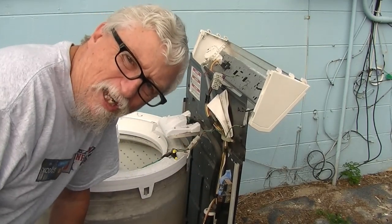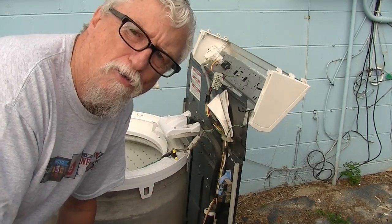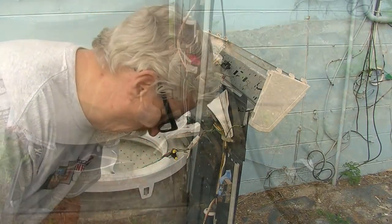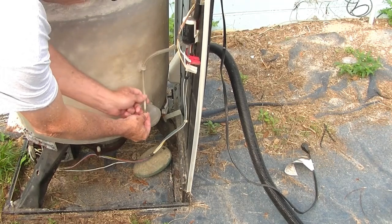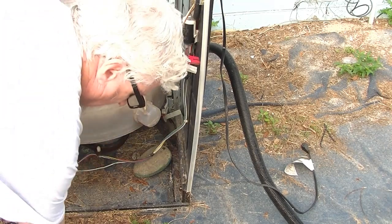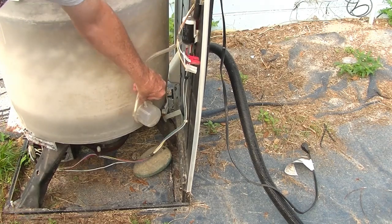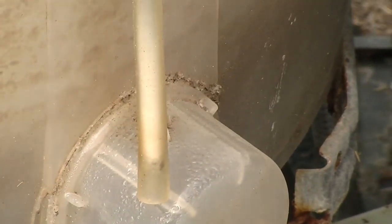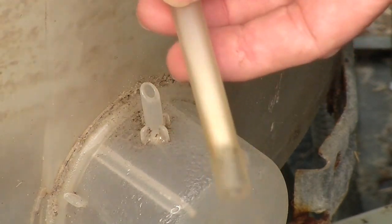There's one more thing — if you can't get the air to go through there, because all these things will make your washing machine overflow and it won't shut off, it'll just keep putting water on the floor. This little tube right here — you see how the soap is on this one? Sometimes you'll get soap and scum build up inside this little tube here. You'll need to take something and push that through and make sure that is cleaned out. Make sure there's nothing in that tube.